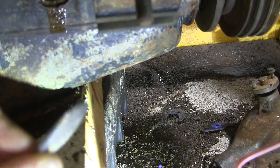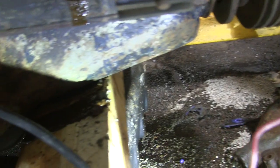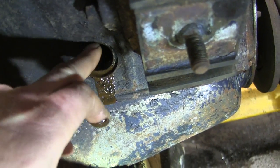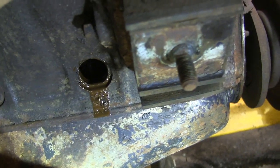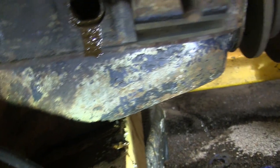They're just a little domed piece of steel, and you put them on that way and hit it with a hammer, and it kind of flattens out and expands in there. And it's got a little landing here. Most of the modern ones don't have that. They're just a hole. So I don't have any of these dome style ones in the right size.